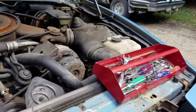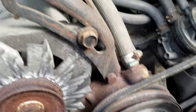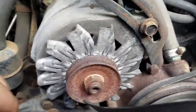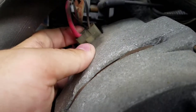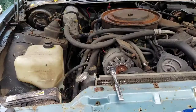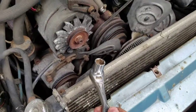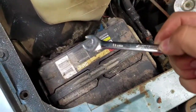I'll be back in a second to let you guys know what sizes you're going to need to take the bolt off. There's a bolt at the top, and then there's a bolt I'll need to take off, and in the back there's a clip I'll need to take off. It's a 15 millimeter for the alternator, and to disconnect the battery it's 11 millimeter.